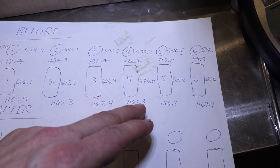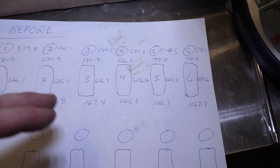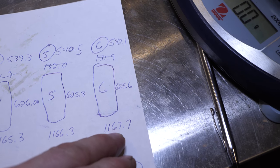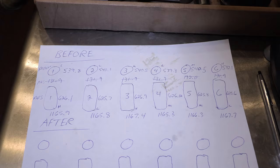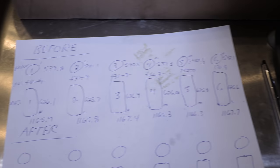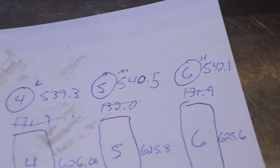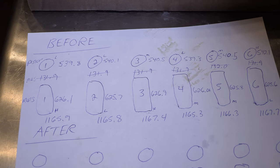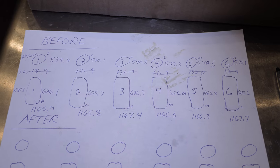The goal is to get these numbers closer to one another. By switching pistons with rods we're going to make this really light assembly a little bit heavier and this one a little bit heavier. The easiest way I found to do this without doing a ton of math is to go through each of the weights and categorize each one as heavy, medium, or light. Then go down to the connecting rods and do the same thing — match up the heavy with the light. Most of the time it balances out, just trying to keep the numbers close to one another.